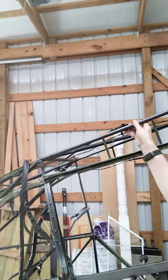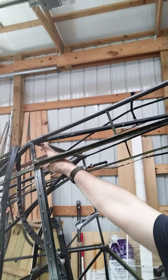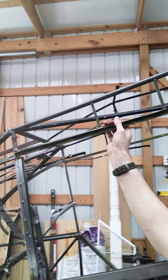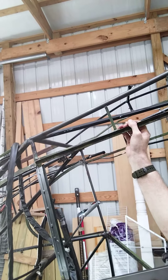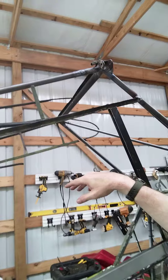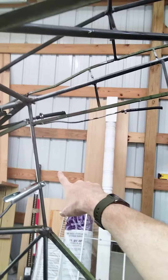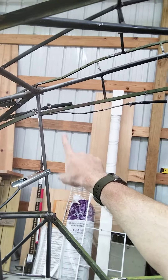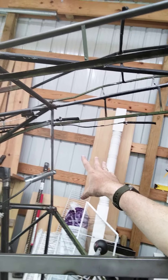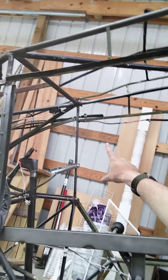Up on top, we had some bent tubes which I wasn't satisfied with just straightening. So I replaced this one — it was a little bit too bent. I replaced this one going across the back, it was a little bit bent, and I accidentally gouged it with my grinder a little bit, so I just bit the bullet and replaced it. That far vertical upright over there I replaced — it's a very common tube that rusts out on Super Cubs and this one was rusted out. It was bent anyway, but it's good to have it replaced.